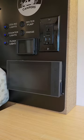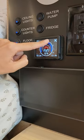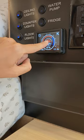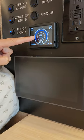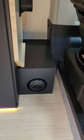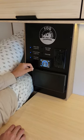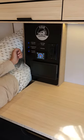And this is going to be your in-cabin heater — it's your gas heater, so it's connected to your gas tank. To use your heater, press, and then simply adjust here. It's a little delayed, but you can adjust your temperature here to whatever you want, and then once you have it set, just press the center button. This little coffee signal means that it is heating up — you will hear it turning on right now. It takes a couple of minutes to heat up. Cold air will come out for the first couple of minutes, but once it heats up you'll start feeling hot air come out. Once you want to turn it off, just press the center button again and a little hourglass will show up — this means that it is cooling down, so air will still blow out for the next couple of minutes, and then it will turn off completely.